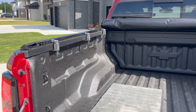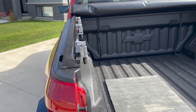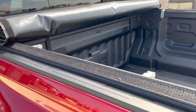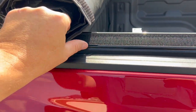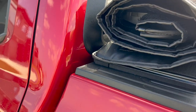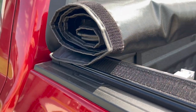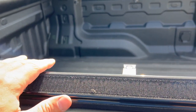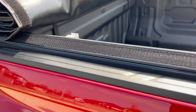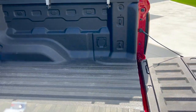In terms of the installation, it comes in three primary pieces: the two side rails and the end rail which holds the cover. What I would advise is to take the two side rails and the end rail, fasten them together, push it up tight, and there's a little allen screw on the inside on each side — tighten that and it's held in place. Then firmly position it the way you want it, with the cover as far up to the cab as you can so it fits properly on the tailgate, then place your clamps.